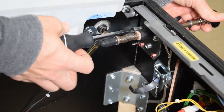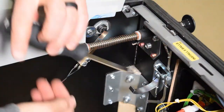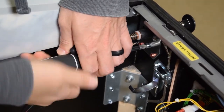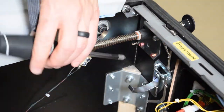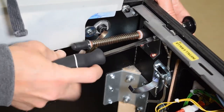The top left screw close to the cabinet wall can be a little difficult to get to, so I would recommend pulling on the plunger and removing it first. Alternatively, you can remove the retaining clip and shooter rod from the housing to get better access to the upper left screw. With all three screws removed, slide the shooter rod and housing out of the pinball machine.